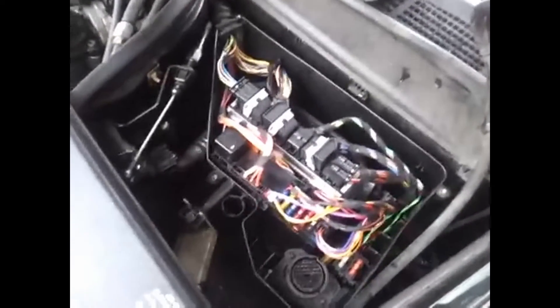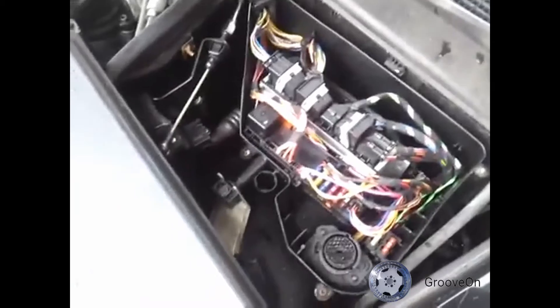I've just put the ECU back in after changing the MOSFET - all the wires are now back in place. Moment of truth. What I'm hoping to see is down here where there are white lines on the outer edge of that disc. That was spinning constantly when the car started and it shouldn't - it should sit idle and only start spinning when it gets to about 2,300 revs. Let's start it up and see what happens.